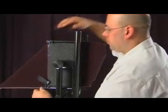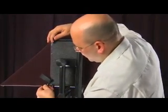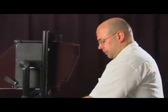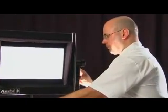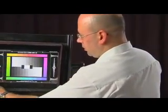And that will, in turn, if you're seeing hotter or lower levels at the top or bottom of the screen, allow you to adjust that. So that's a great little feature of this instrument. And I'm just going to set it more or less where I had it set. It's not critical, but definitely if you're having a problem, adjust it, because that's what got it fixed for us. I was always seeing about a 1/10 of a stop difference, and that alone fixed it. So it was just adjusting the mirror angle. All right, so we'll just clip this little shield back on.